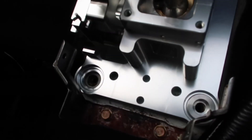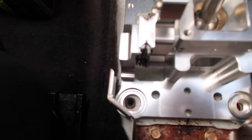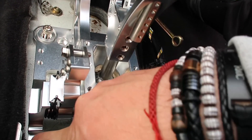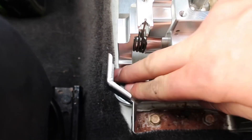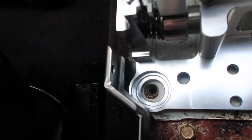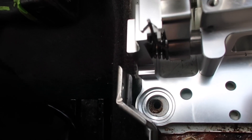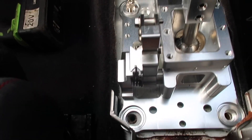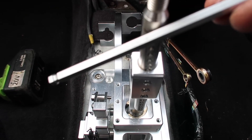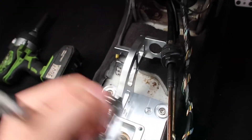Just as I was about to start putting the bolts in, I came across the first flaw of the replica shifter — the hole is not a circle. It's more of an oval shape, which means this part here is not fitting down in; it's just sitting at an angle. I'm going to have to get that out and file the edge off. Not a big problem, but it just shows you — these are the little things you maybe wouldn't find with the genuine K-tune one. So just a wee bit of filing on this edge. Got that to drop in. With a 6mm Allen key, tighten down all the bolts. So that is the shifter fitted to the car.